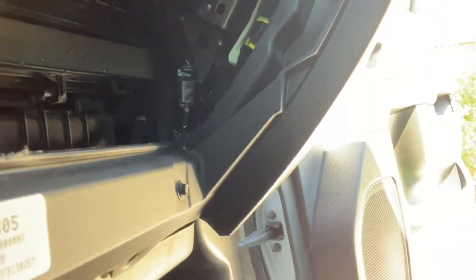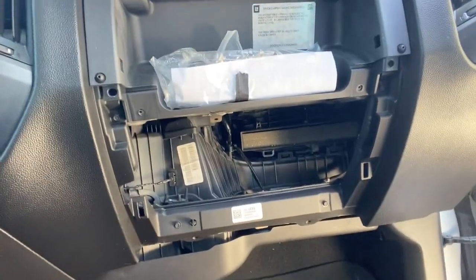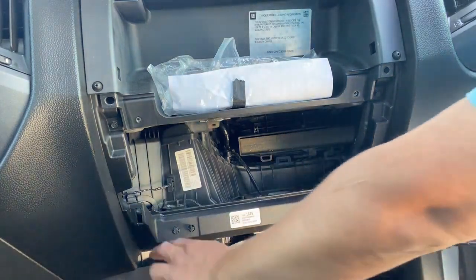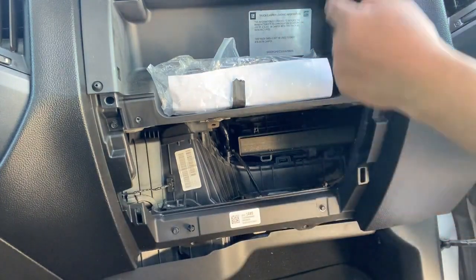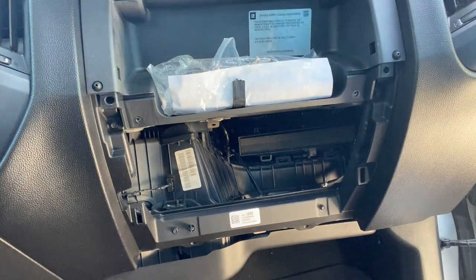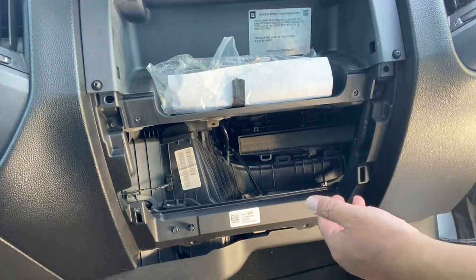You can see a little bit of debris in there. I'll probably wipe it down. A lot of you may or may not know that when you have your AC or heater on, the vehicle's blower system pulls air from underneath your hood. If you park under trees, you'll have debris that gets stuck in your filter, and sometimes that inhibits your airflow.